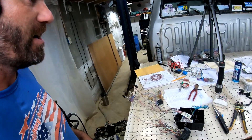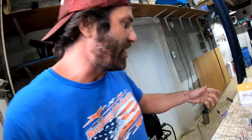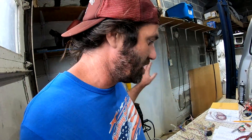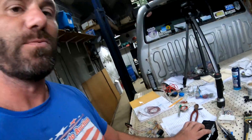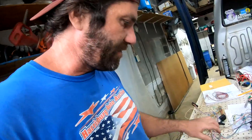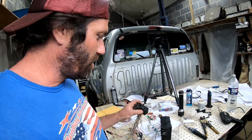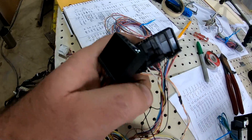Mikey Swartz back here again in the garage with the Tecundra. Look at this mess we've got going on right here — oh my god. We've really simplified this harness. We got a lot of wires going, and in fact more of these are gonna disappear too. I hate to cut stuff if I don't have to just yet, because we're gonna need some leads here and there to run wires. Anyway, we're gonna get rid of this junction box completely. I'm gonna pop all these connectors out of here — these are the only four connectors we're gonna be using from this box. We're just gonna pop them out and plug them in under the hood. We're gonna have to extend these wires since the junkyard cut them so short. We gotta lengthen them because this is gonna have to come through the firewall along with these plugs. The other side of this stuff — for example, the four-wheel drive ECU — that's what these are for.